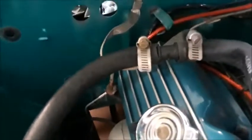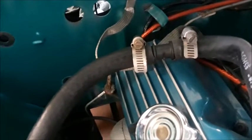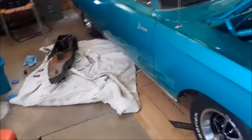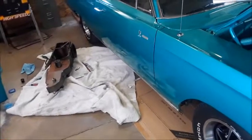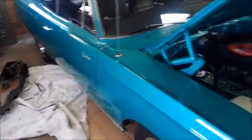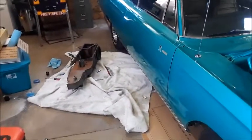I want the car drivable. I did the old O'Reilly's heater hose bypass trick — a heater core bypass. Very temporary. I want to keep Beep Beep mobile. It could be several weeks before I get my heater core back. Once I get the heater core cleaned up and boxed and ready to go to Glen Ray, I'm going to put the heater box aside for now, get the interior back together, get things wired up so I can spin the car around. We'll update you when we get the new core.